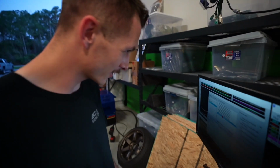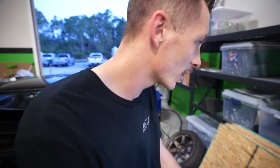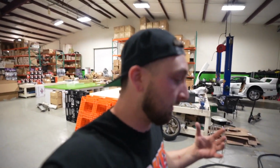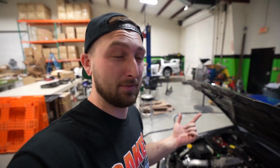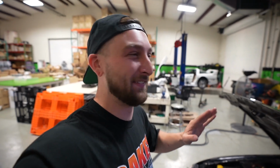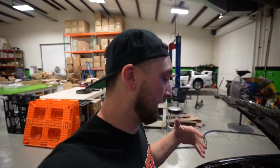This might be his car. He made 464 horsepower, 400 torque. That's a good number. How much boost are you running? It's modest. Adam's tuned on Ignite, a race ethanol. I am on Florida pump gas. So we're going to hold back a little bit, because even though the engine's built, knock is knock.